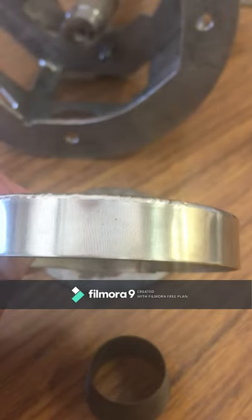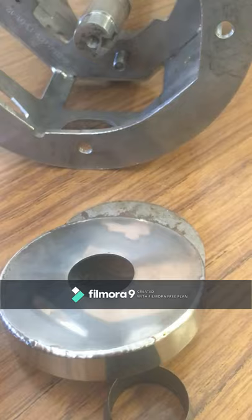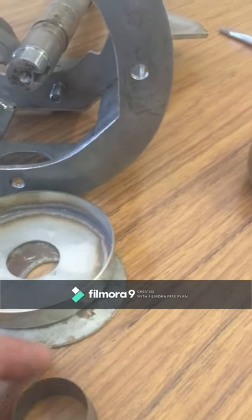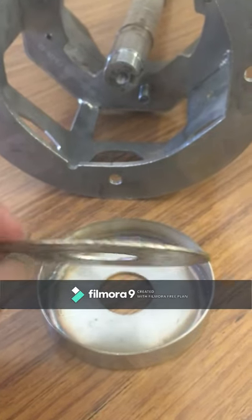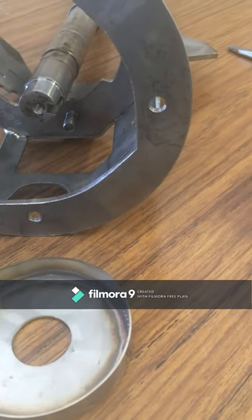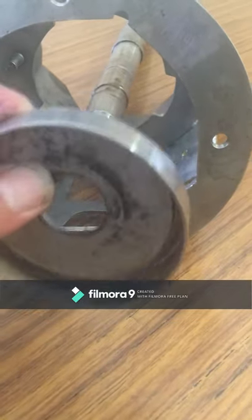The mushroom flinger plate is the first thing to go back onto the oven shaft. Apply a small amount of silicone around the top before placing it in. Slide it up onto the shaft and use the tapered collar to retain it in position. With ovens that have several flinger plates fitted, only remove one and replace it with the mushroom-style flinger plate, placing the required amount on the inside. Apply a smear of silicone around and up into the oven.